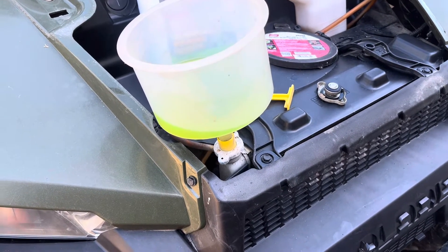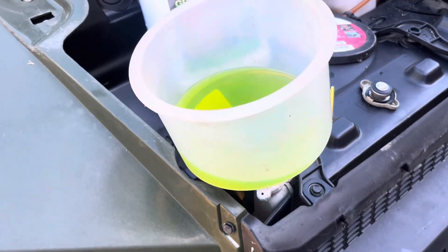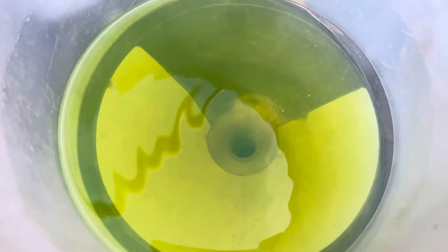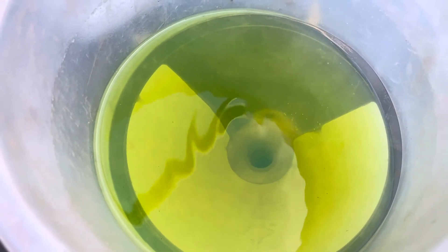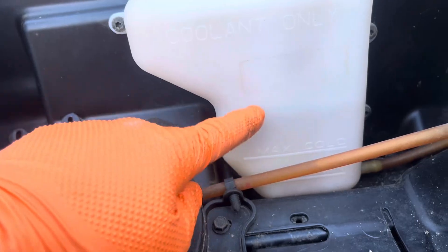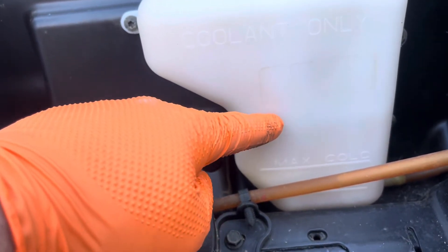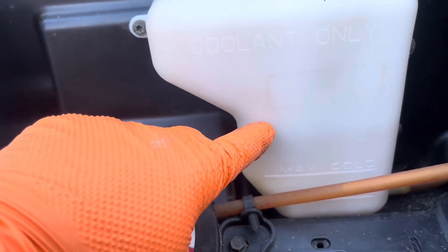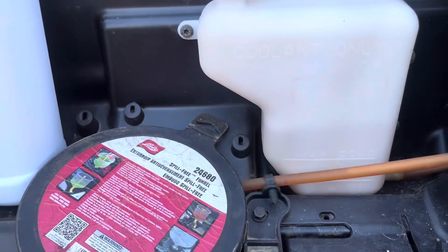As you can see from the time lapse, the coolant temperature has been acting a lot more stable and in a normal range. I've heard the fan kick on and off a few times and the temperature's staying in that range. There are just some little bubbles coming out — this is totally normal, sometimes it takes a little bit to get the last of the air out. Last thing I'm going to do is top off the coolant reservoir to about the max cold level — it's hot now so as it cools down it's going to pull some coolant back into the engine. Once I put the radiator cap back on and everything cools off, I'll run it again up to operating temperature with the system closed and check the level one more time before letting this go back to the customer. Hopefully this video is helpful — overall not too bad, just takes a little while. Please like, comment, or subscribe. Thank you.